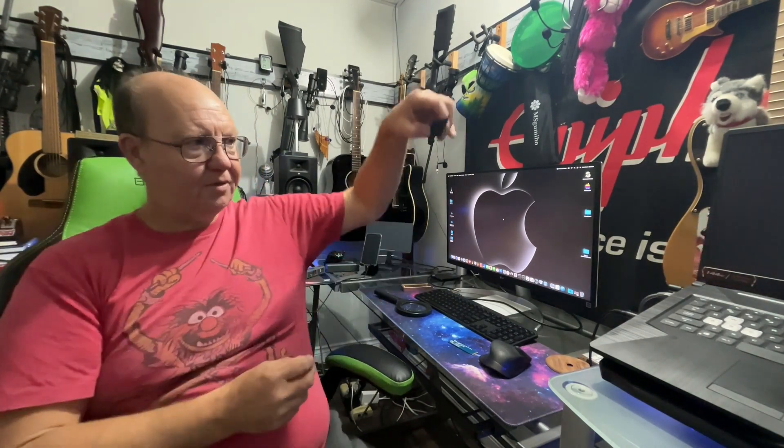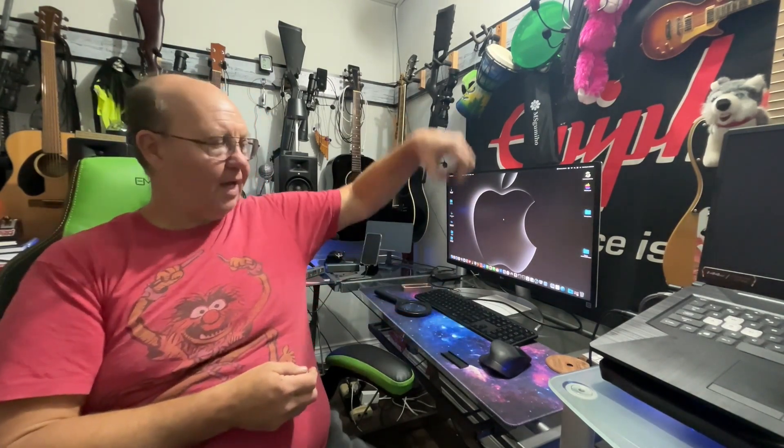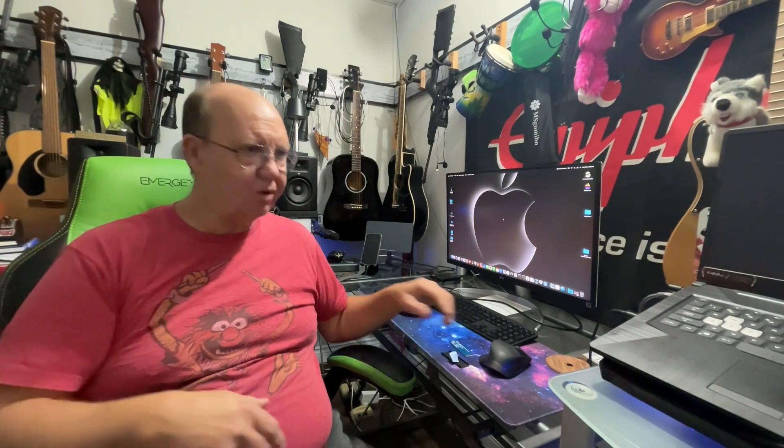You can't just use the silicone pad alone because in a laptop the drive hangs upside down with chips facing down, and the pad won't stay. The amount of heat generated in gaming laptops is massive compared to basic machines. Basic non-gaming laptops have never needed any kind of cooling pads from the factory.